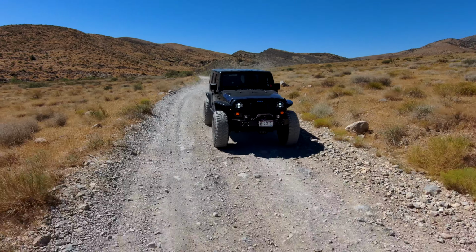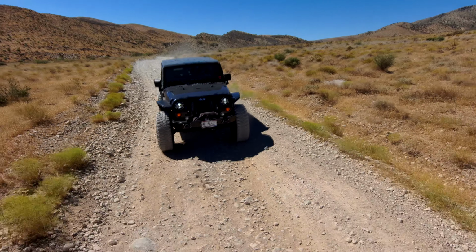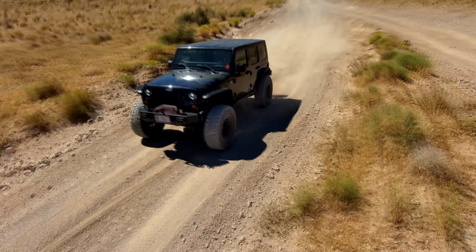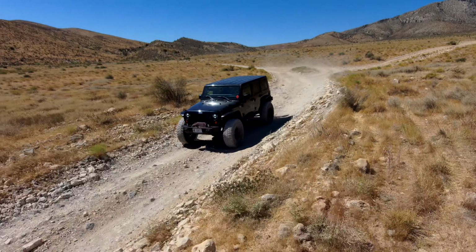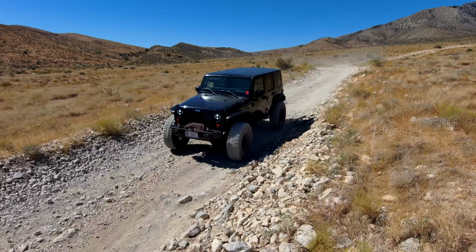Now, I haven't run one of these engines for hundreds of thousands of miles. I've seen LTs with hundreds of thousands of miles on them, but I will say that we have a lot of LTs out there, and the combined mileage is easily over 100,000 miles, and we're not seeing massive failures. We're not even seeing minor failures. Now, we are seeing things like fuel pumps go bad and a coil go bad and things like that, but as far as the doom and gloom from some of the guys that can't support the LT, we're not seeing that at all.